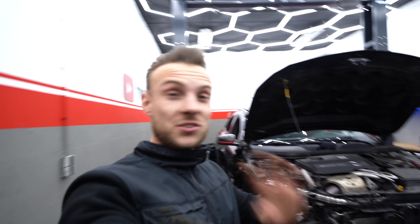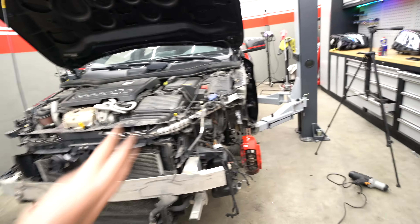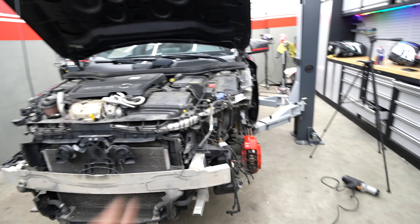The shock absorber is reassembled - it wasn't a very difficult task to replace. It actually went quite smoothly. You just have to pay close attention that the coil spring comes back into the saucer in exactly the same position to achieve the same ride height and fit right as it should. My brother was indeed right - the negative camber is completely gone now and it stands up nice and straight again. I'm going to put the wheels on and install the headlight next, because we've got new original headlights. I'm looking forward to driving it, and hopefully we can also remove our steering gear errors because our steering gear isn't working either.